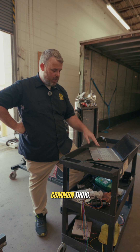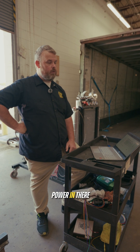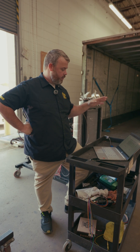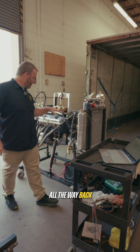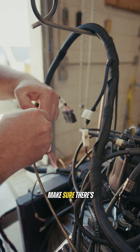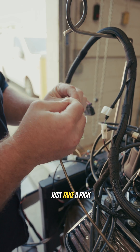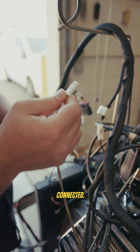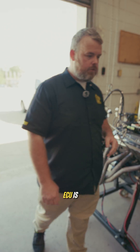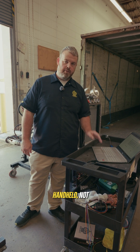So that's a common thing, and there are a few of those out there that do that. No handheld power — I put that in there because it's kind of related to the same thing. If you're trying to do this with your handheld or your laptop and it's not communicating, you need to come all the way back to the system and make sure all these pins are in good health. Especially on this side, make sure there's nothing wrong — if you're worried about connection, pull the rubber out and make sure all the wires are connected. If there is a problem, give us a call. Make sure your fuses are good, make sure your ECU is powering up, make sure your ignition switch 12-volt is good, because all those things will make it not talk to the handheld or the computer.